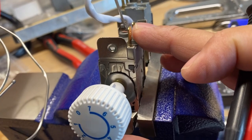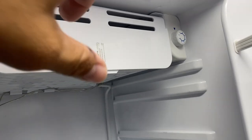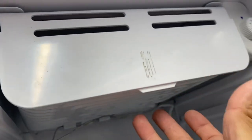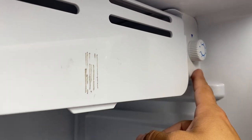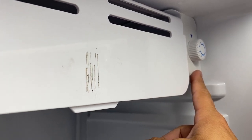I just fired it up. To install this, it's a little tricky to get the old one out — you have to push down, or push up right above those screws just a little bit, and then pull this in front so it kind of hangs down a little bit. This is a very stiff pipe so I wouldn't really bend it that much — just bring it low enough to be able to get this thermostat disconnected.